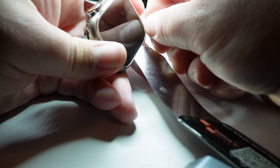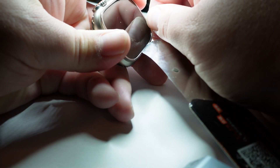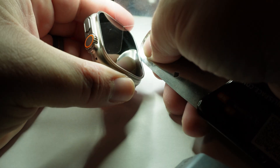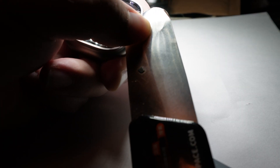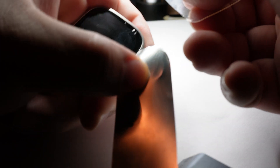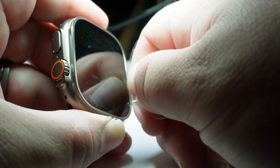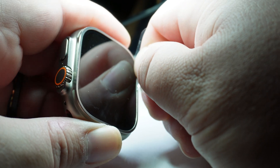Then I can slide the plastic around the corner and up the top here. A little bit more alcohol acts as kind of a lubricant. Stick my pry tool back in there and give it a bit of torque. We'll just continue to do the same thing over and over again until we break through. Eventually you'll feel it slip in and then it's just a matter of working it around the edges.